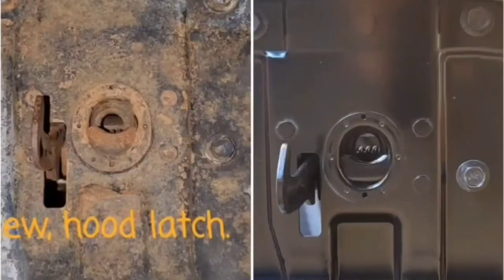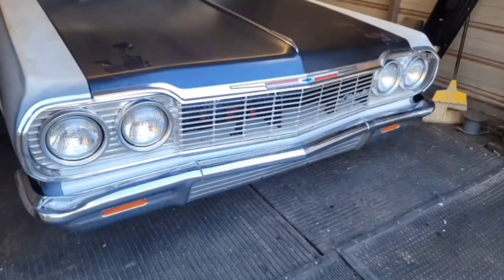This right here is my hood latch — a detailed view of how I took everything apart, cleaned it up, and painted it together. Every screw in this car I sandblasted, anodized, and painted. Basically it's brand new — every single part inside and out. I had to get a new hood because it had rust holes through the cross members from the factory putty. The front lip was rusty, all the screw tabs broke off, so I bought a whole new chrome lip with the emblem. The front bumper came off, sandblasted inside, painted, and the whole grill and all the buckets came off.